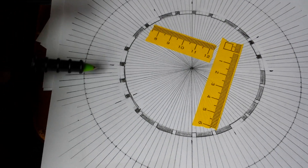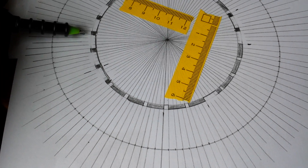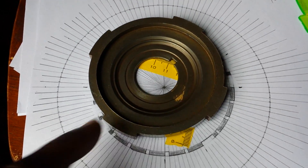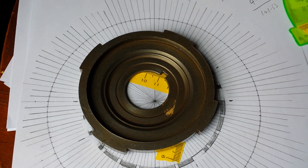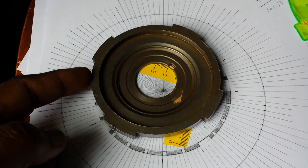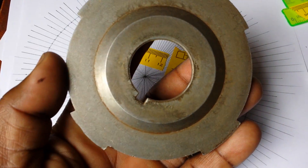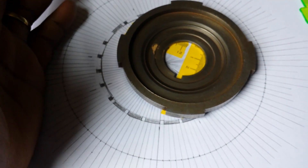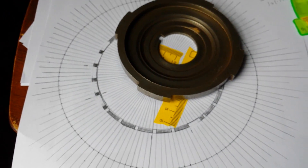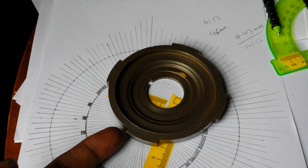I have what the teeth are going to look like, and I've cut out these little pieces. But before I cut them out I need to figure out exactly how it's going to be phased on this. My first step is to weld this in so I have a blank, then once I have the blank I'll put it on the crankshaft at top dead center, put some lipstick through the hole where the sensor goes, and see where it touches — so I'll know exactly where I need to arrange top dead center.